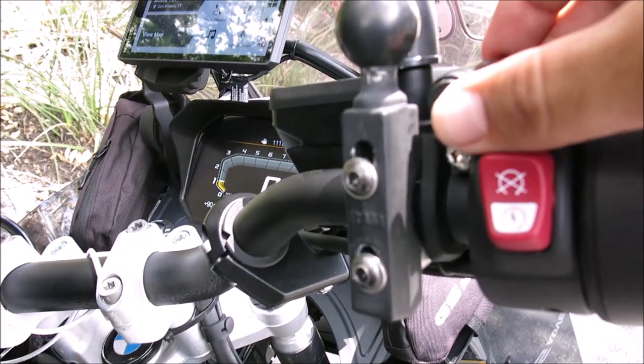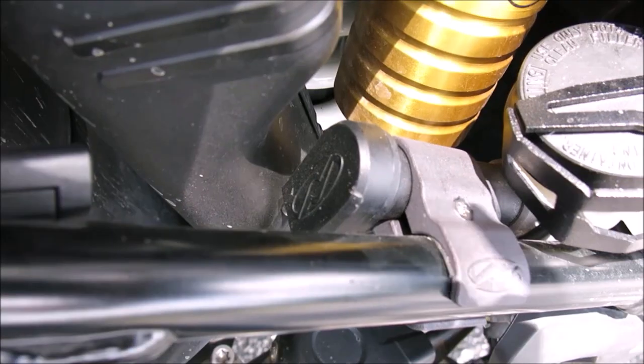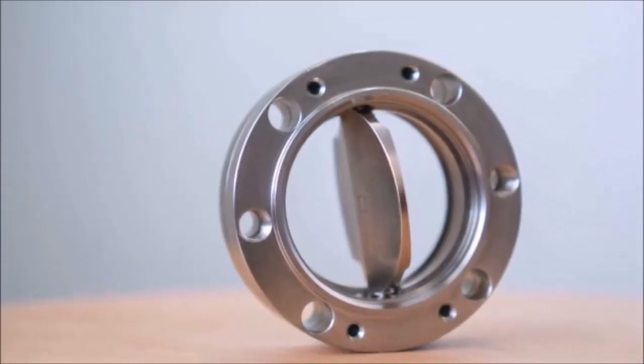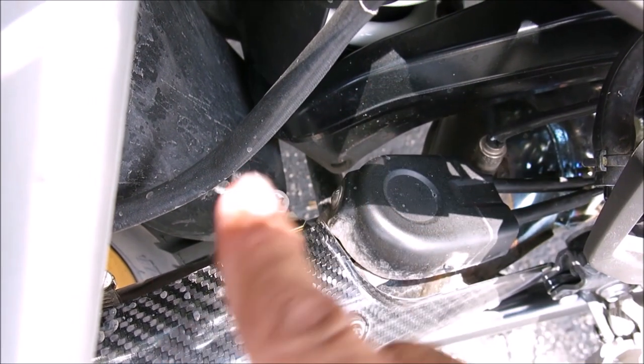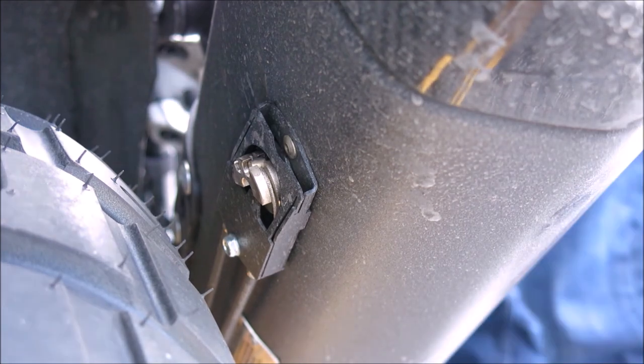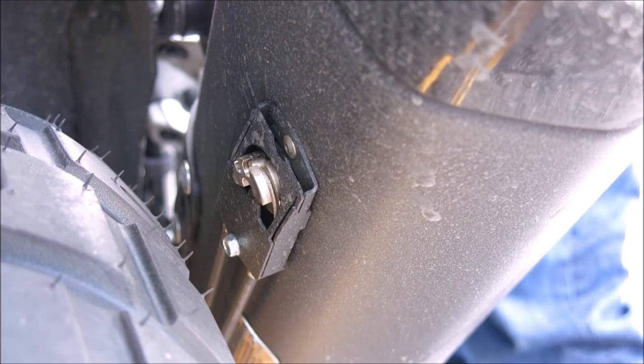Here's how it works. This illuminated handlebar-mounted switch actuates the servo motor, which in turn adjusts an internal valve located in the interior of the exhaust system via heavy-duty waterproof cables. In Dr. Jekyll mode, the valve is closed, diverting the exhaust gases around the valve and through perforations on the side chambers of the exhaust, where they pass through patented single-strand fiber dampening material before being routed out. This is the quietest mode.